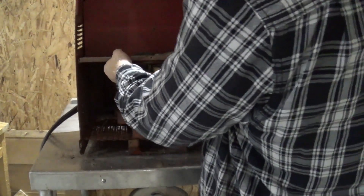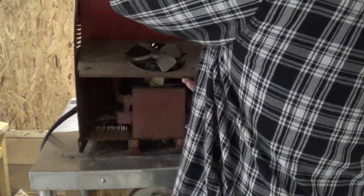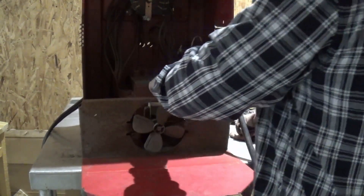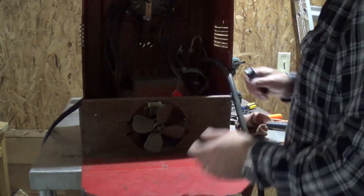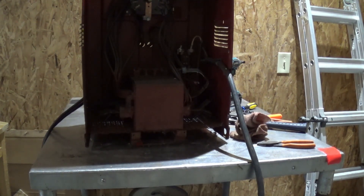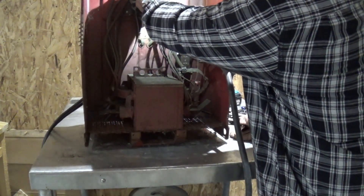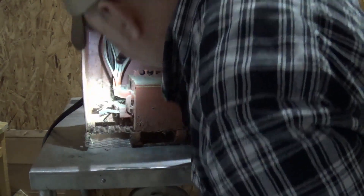That wire is awful tight, but I'll get myself plenty of wire to work with. I'm just going to cut the fan wire — I don't want to mess around with the connections in here. Now I can clean this up on its own without having to worry about it dangling around and the wire getting messed up. I'll take the power cord off, take this outside, blow all the dust out. The contacts actually don't look too bad — I'll use some contact cleaner and some sandpaper just to clean it up. And I'll clean up the inside here, then start working on the chassis, stripping it down, getting it ready for paint.